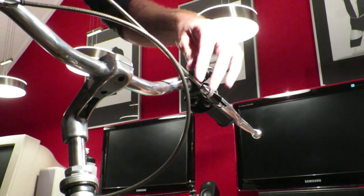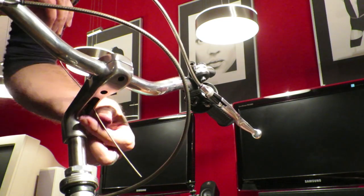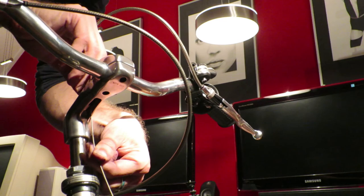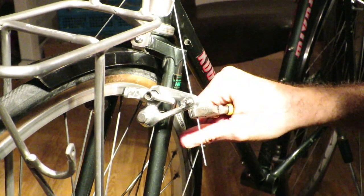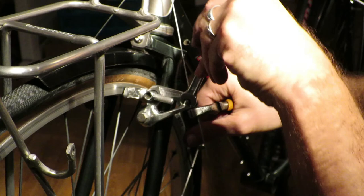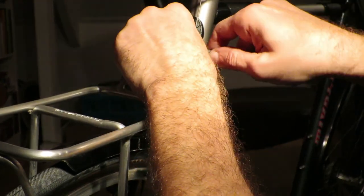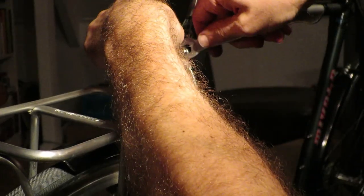With the cable in place, this is the front brake. I'm doing the front brake here, which goes through the stem. I also need to use an extra piece of cable because this old-style cantilever brake works with a cable yoke. First I put the extra piece of cable in place, then tighten the cable yoke, and it's just fidgeting around to get the right placement of both cables and fine-tuning the brakes.